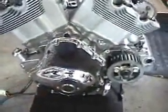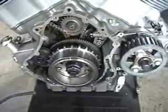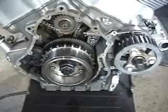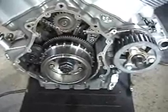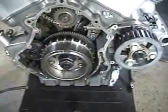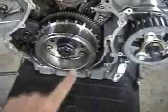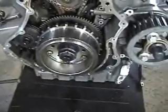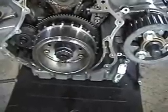I've now loosened all the bolts on the alternator cover and pulled it off. Remember that when you remove the alternator cover, the stator magnets are inside your housing — so when you pull it off, it's going to have a little bit of resistance. Just pull it off. Once you break the magnetic field, it'll come right off in your hands. Be careful not to drop it.